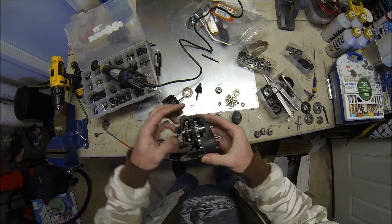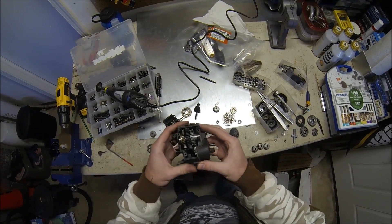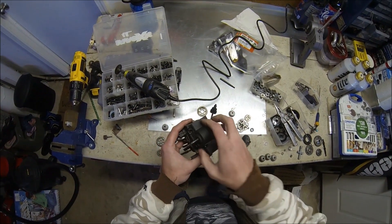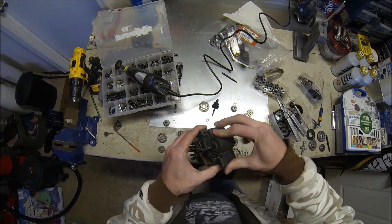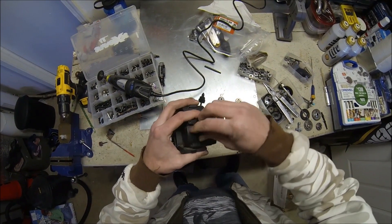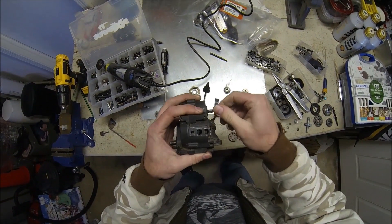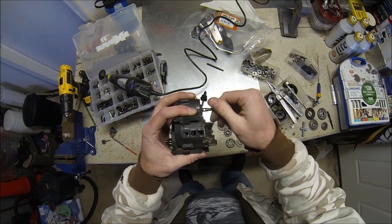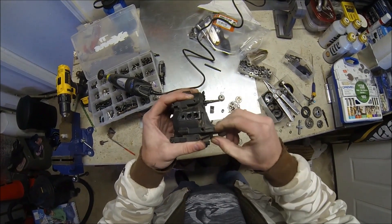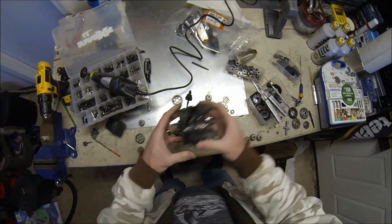You want these gears to be lined up as much as they can be. When we put the top on, everything looks good and works — no movement. See down here, this needs to be shimmed — this was my Flux tranny.